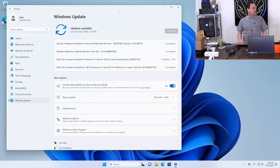John English says, I deleted the video driver on the GTR7 and it worked. Well, it didn't really work, John. What we did is by removing the AMD driver, Windows defaults to a very limited basic video driver, which hinders the performance of the machine. That means we can't increase the resolution and we're not going to be running at the performance levels. So this isn't just a matter of making the video fit on the screen, because using the basic driver is like saying never take your car out of first gear and you'll never have a problem. That to me is not a fix, but we do know it's driver related.